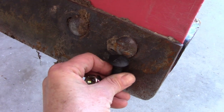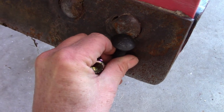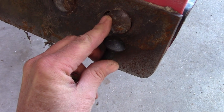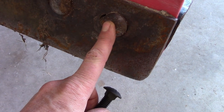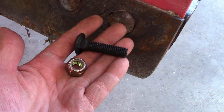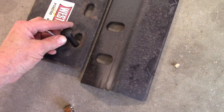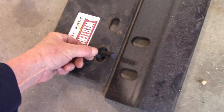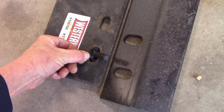I'm going to reuse some bolts because the bolts that came with it are just a lot smaller. I'll show you what that is. You see the difference in the head there? That's the factory one, and this is also a factory one but it's a replacement bolt — it's like half the size. So I'm going to reuse these old bolts. The chance of snapping them off is slim to none. That's just not going to work out right because there's no way I'm going to be able to hold and tighten that down — it's a carriage bolt and look at the size of that. So we're not going to use them.